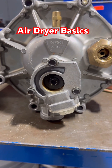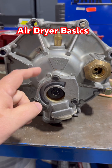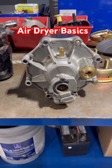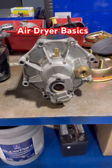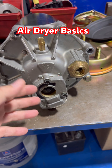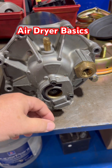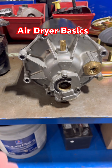If you work on a lot of trucks you're probably going to end up doing a lot of rebuilds on these purge valves because they get gunked up. Air compressors will pass oil, and some of that oil may find its way in here — oil mixes with water, forms a sludge, gets this thing all nasty. Plus you also get road dirt and debris up in it sometimes. So quite frequently you'll take these off, pull them out, buy these little kits that come with new o-rings, clean it up, replace the seals in it, and put it back together. It's a pretty quick job once you've done it a few times.